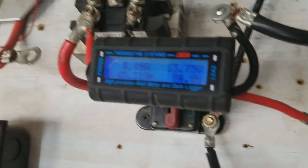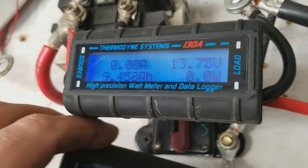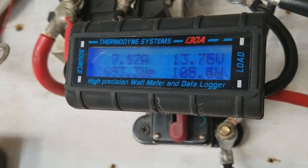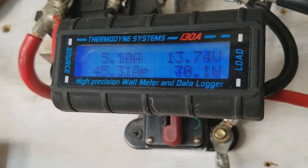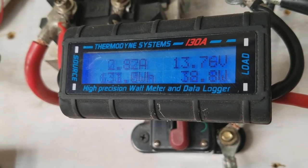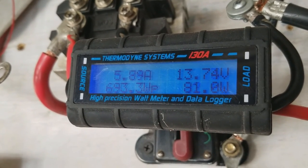I've got a couple other batteries I need to hook up and get charged. I also have this meter — I put some 5/16ths ring terminals on both ends. Makes it nice for hooking up to batteries. Most batteries use 5/16ths; some of the larger ones use 3/8ths terminals — the big tractor-trailer batteries use 3/8ths. Most golf cart batteries use 5/16ths terminals with either half-inch or 9/16ths stainless steel nuts.